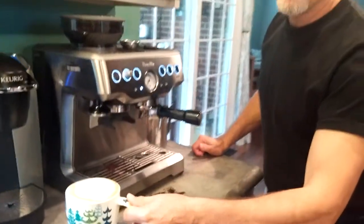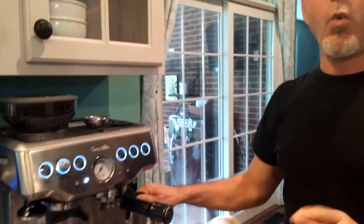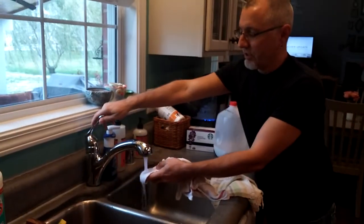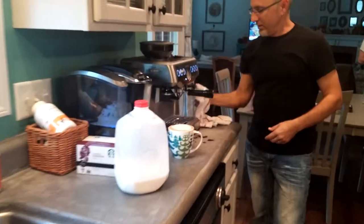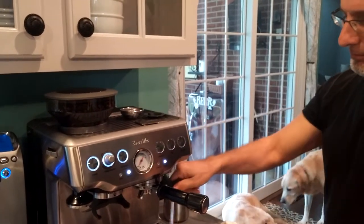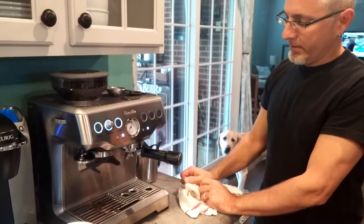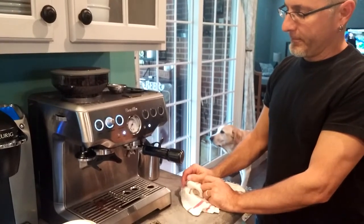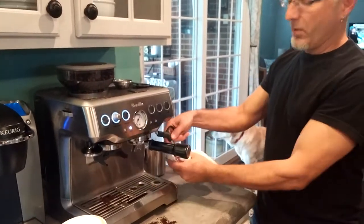A very important thing is the care and condition of your machine, so we've got to clean the machine. Mainly the frothing wand doesn't get dirty. Any kind of towel will do — you might want to pick which towel you're always going to use so that somebody's not wiping down a table with a milk-saturated towel. Just dampen a towel, rub your wand, and give it a couple of seconds to clear the wand. That way it won't get clogged up.